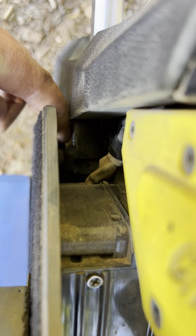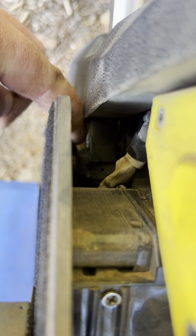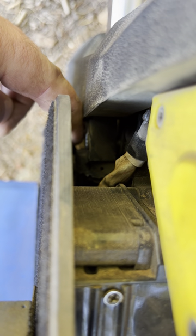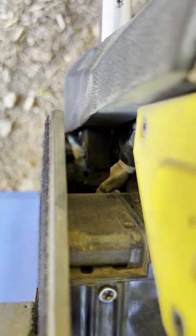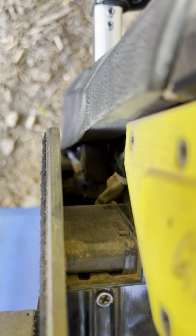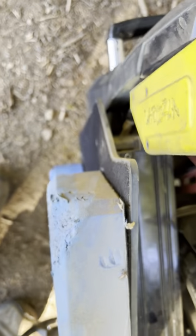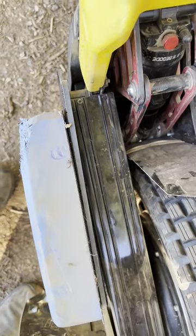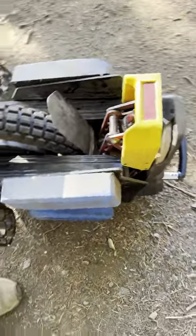Right there is the bushing, and you can see the holes I drilled in it. The little O-ring that comes with it sits between that and the slider part, so it doesn't slam hard on rubber — it's more of a progressive stopping. That makes the biggest difference riding it. I feel I can just rip over bumps, and when it does bottom I don't even know it, or it bottoms softly. It's way less noisy when the suspension fully extends.